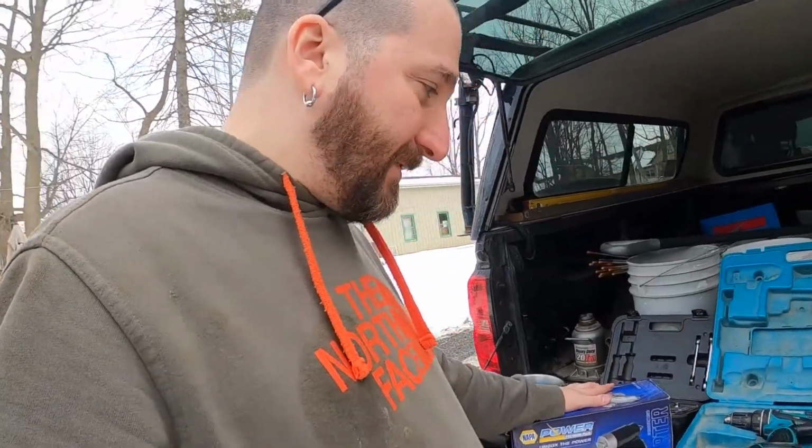Hey, what's going on? So in today's video, I'm going to be replacing this starter in my 2016 Chevy Silverado 2500. I went out to plow the other night at 3 a.m. Turned the key, dashboard lights up, truck won't start. Tried jumping it and everything, that wasn't the battery. So pretty much, I think it's the starter. So I just picked up a new starter at NAPA and I'm going to be swapping this thing out.